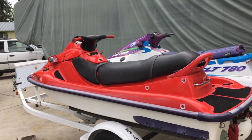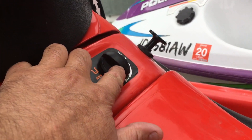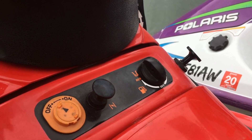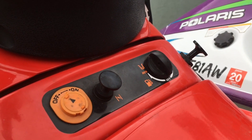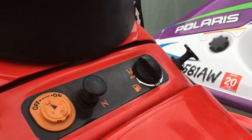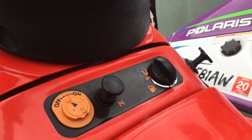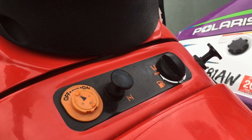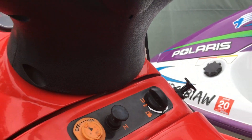Here's another how-to video. The complaint is: if I leave the fuel setting in the on or reserve position and park overnight, when I come out in the morning the engine is flooded and I have to remove the spark plugs and turn the engine over to get the fuel out. If I leave it in the off position I don't have that problem. If I leave it on for just 20-30 minutes — like going to eat lunch — I'm usually okay. It's only when it sits overnight.